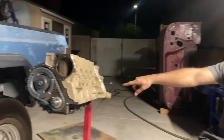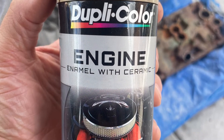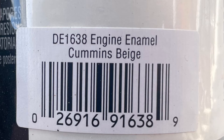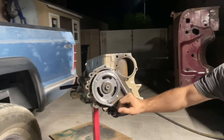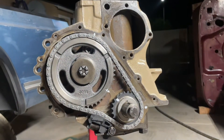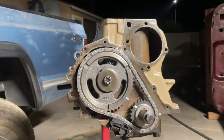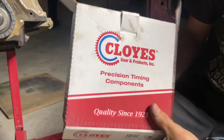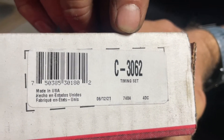This is a new four-cylinder engine. I painted this one Cummins beige. We have the pistons installed, the crankshaft and camshaft are installed, all new bearings. This time there was enough wear on the chain that I decided to get a new timing gear kit — the Cloyes, exact one is right here: C3062 timing chain.